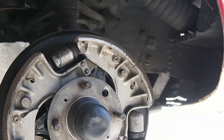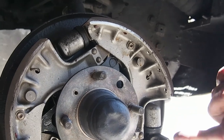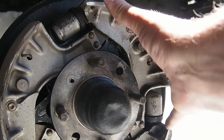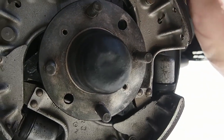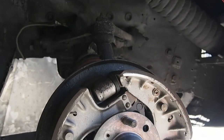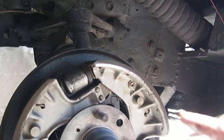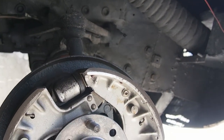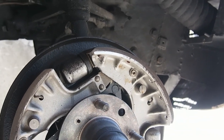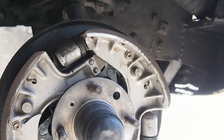The setup of the braking system is what is called a leading edge shoe. It's pivoted here at this end, and it pivots this way from this piston. That means that when the wheel is rotating this way, it actually cuts into the braking. Whereas if it were a trailing edge, it would be a more mundane braking experience. So it's a very efficient setup.